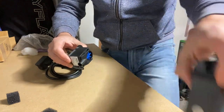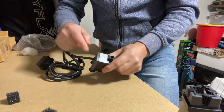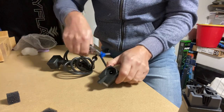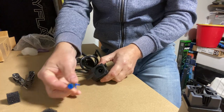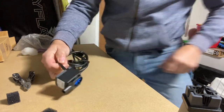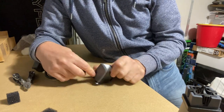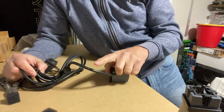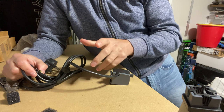Anyway, I've just broken this down - I'll show you how it breaks down. Dead simple: hold it to the back, snap it off, put that part to the side. You're left with your power head, your pump if you like - bog standard as in with every filter. It has a little propeller there - good quality plastic, doesn't bend, magnetized. You've got a hole in the middle and a pin that slots in, and that's it. The cable comes out the bottom.